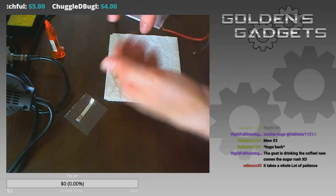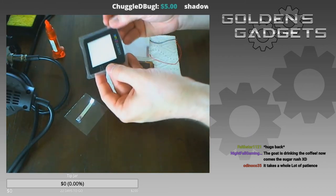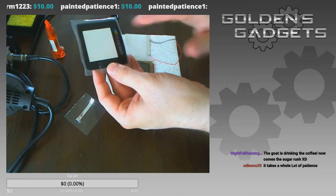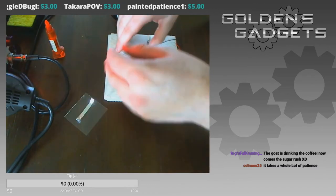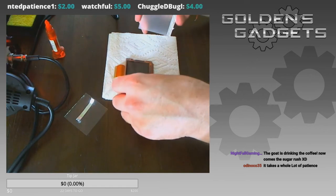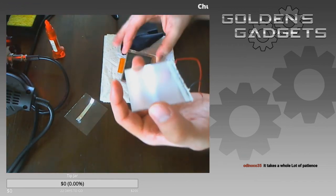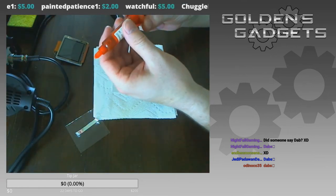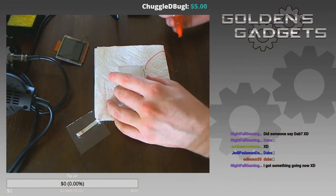I need to make sure everything is properly wiped off — checking the lens again, and I've got a little mark on there. I think we're about ready to apply the LOCA. This is the most delicate step. Once it goes on, it goes on — you can take it apart and reattach, but I just hope I get this right. Gently placing it down. It's a little runny so it'll slide around. I'm using a paper towel to get a good grip while flipping it over.